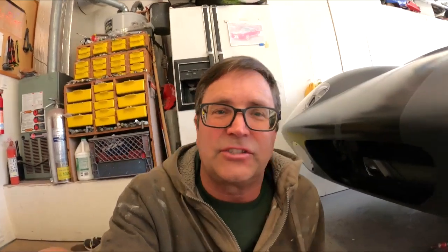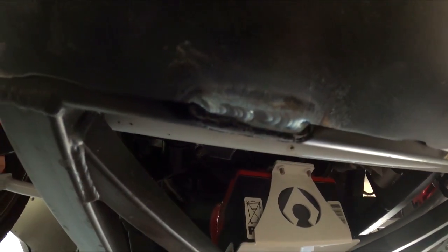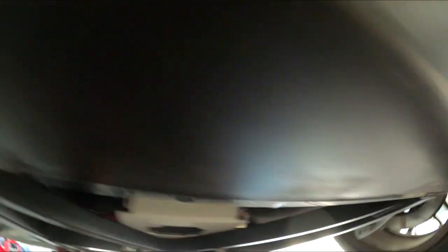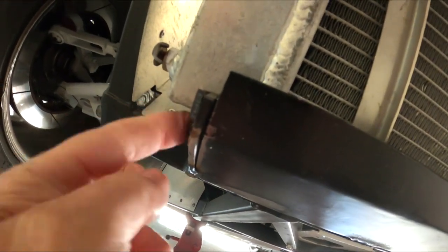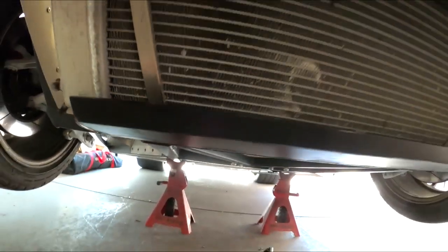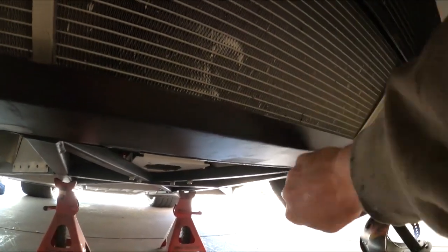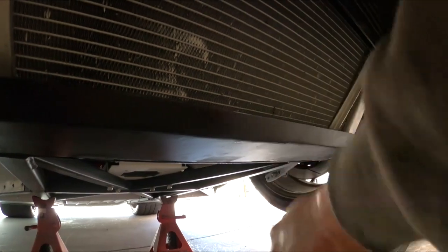It's now partially welded in. I've started welding up here and I'll finish stitch welding across where I've cleaned up the metal — about five spots — and then on the edges I'll do it quick to not burn the rubber that holds the radiator in. What do you think? I think this will protect that radiator. It's rock solid already and I've only got a couple tacks in there. We'll finish welding, touch up the paint. Shoutout to Factory Five — they could do this mod, which I think would be a great thing for them to do.